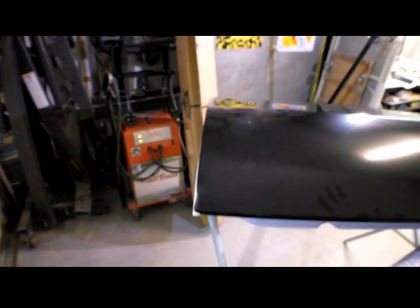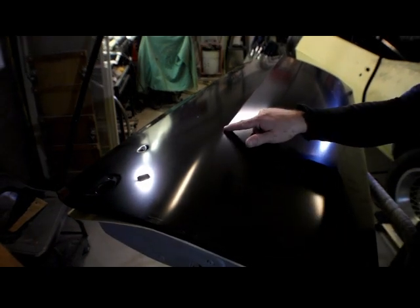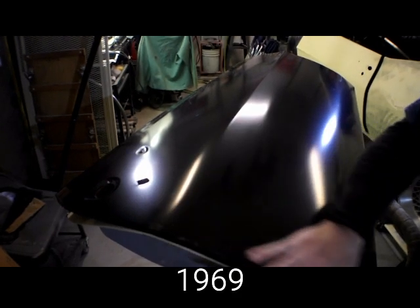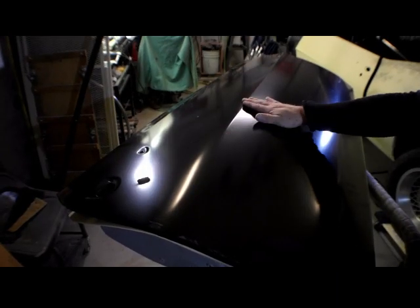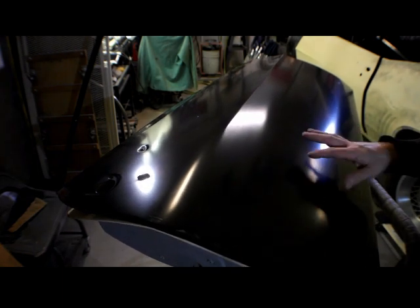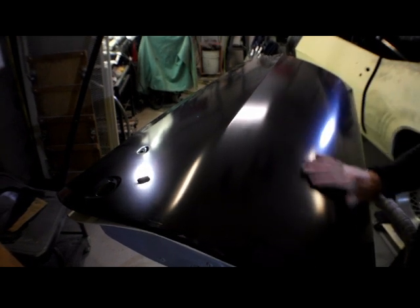And then up here, this body line is crisp. It's crisp for too long. And I did another Doorskin on John's other 68 back when I was at Hot Rods. The video is up there on the YouTube channel. And we can correct this, but I just wanted to get that shot of the brand new Doorskin on the shell, all hammered and hemmed in, and not have a bunch of body filler, to just have that sheen of this beautiful E-coat shining without flaws.